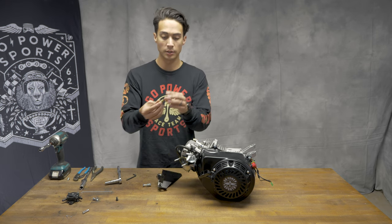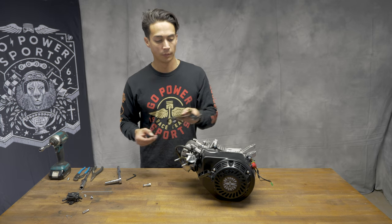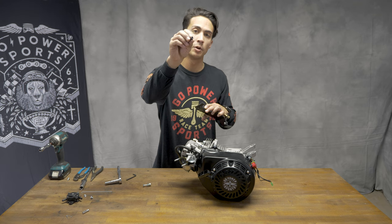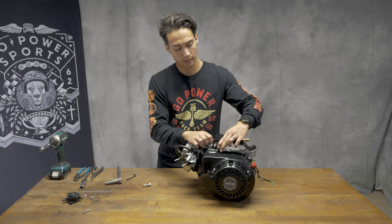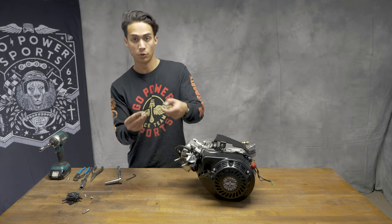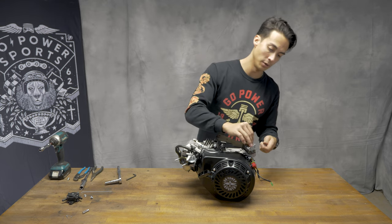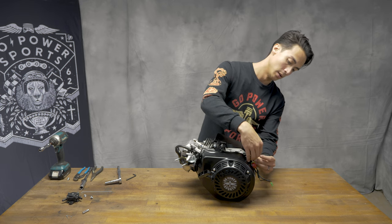This gold piece does unscrew — be careful, there is a small little ferrule piece inside of it. Now that we have the gold piece that holds your throttle cable installed, we'll mount the half top plate onto the engine. We'll start with the back with this black allen head bolt and screw it right in towards the back. Then we'll take the long bolt with the two washers — bolt, washer onto the top plate, the other washer underneath, then you're knotted.